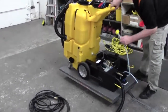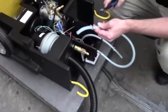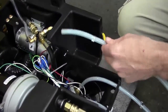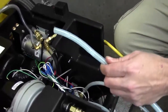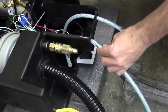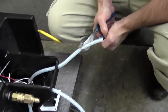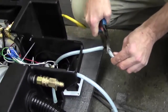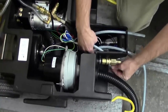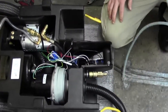If you've got the yellow chemical cap, you'll need to take that off. There are three clamps on these hoses — I use some diagonal cutters and just snip off one side of them, then grab the other side and pull it off. We've got to take two of them off on this one and one on the other. Once you get the clamps off, go inside and grab your valve and feed these hoses through. You are ready to put on your new three-way valve.